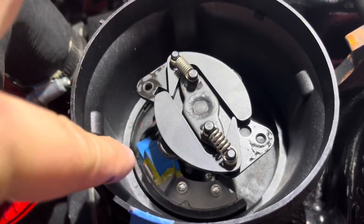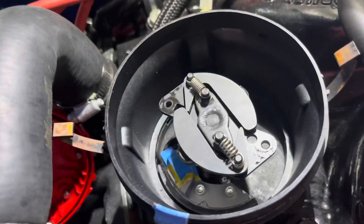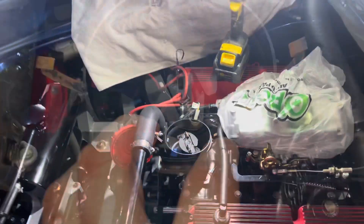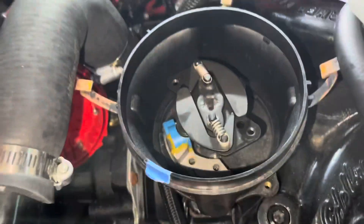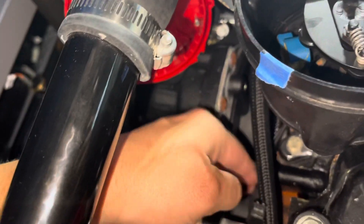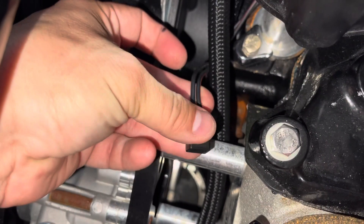Because you're going to have to put that back to remove the coil — the magnetic pickup — which has a little coil here with the sensor. You don't have to remove the whole distributor. You just have to take these two screws out and that's it. Once you remove the two screws it easily comes out — you can push it out. But remember you still have to take out this clip right here.